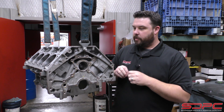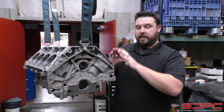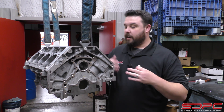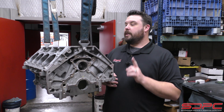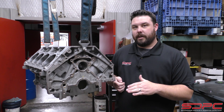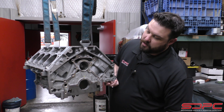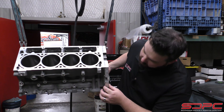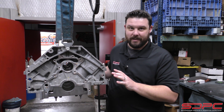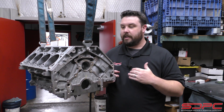I'll go ahead and start by saying this is actually a customer's block. We've got permission to use it for this video — we appreciate it, buddy. But it's about to be machined, about to go into the race shop. His parts have finally arrived after several months of waiting for a nice 416 stroker. Before it went in, I wanted to show you how all this worked. This is a new GM block. Some of you may have already noticed it's missing the transmission locator dowels, and it's also missing some other plugs on the side for coolant passages and oil passages. That's because GM blocks come like this — if you order a bare block from any Chevrolet Performance or GM dealer, that's how it's going to come.